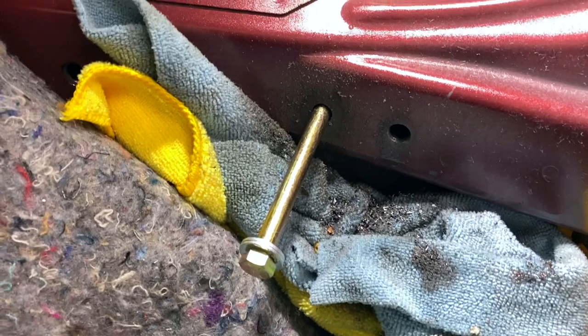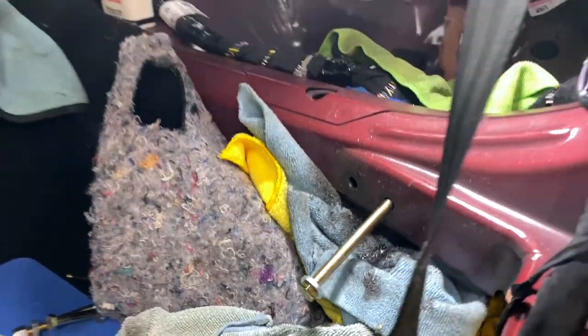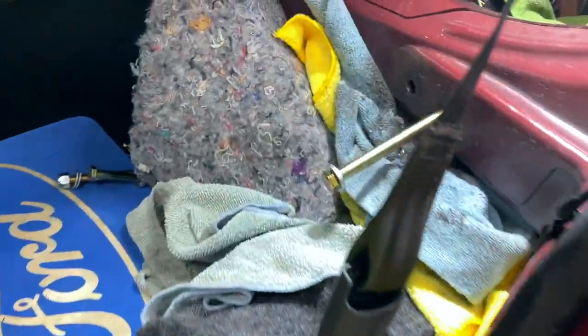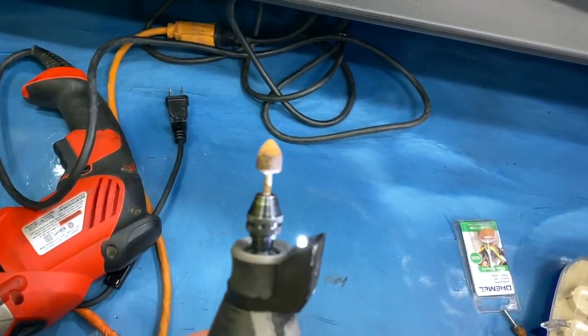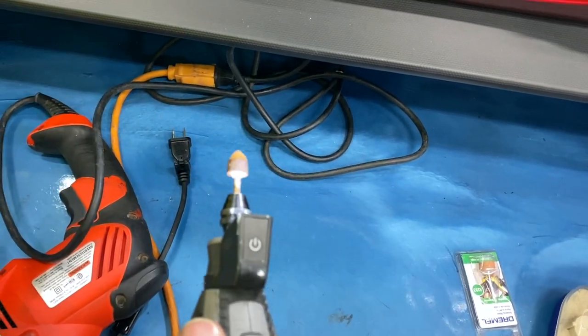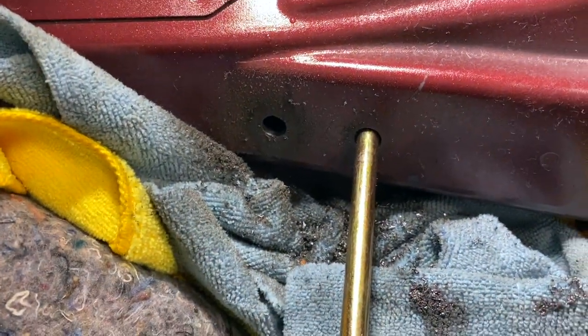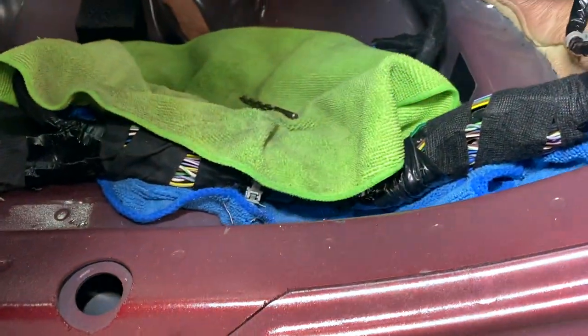Front side done — proper size holes. I'm not going to lie, it's tough. I used three-sixteenths bits, switched to a quarter-inch, tried that, then tried the big included bit, but it was a bear. Thinking outside the box, I switched to a Dremel tool with grinder bits. Since I already had pilot holes, I worked and elongated them — when one gets too hot, move to the other and go back and forth. Then I came in behind with the big included bit and it worked. Now repeating on the back side.